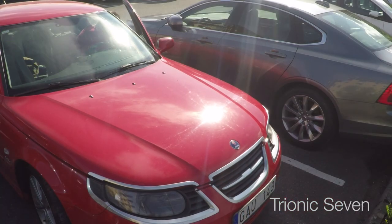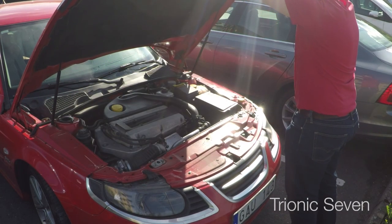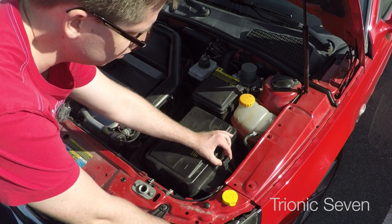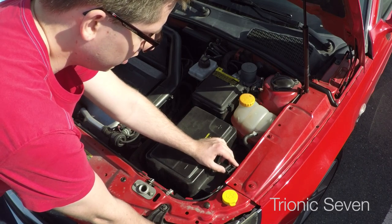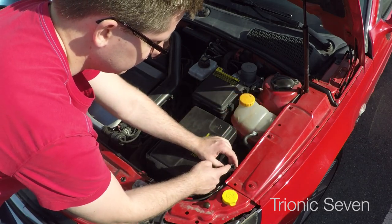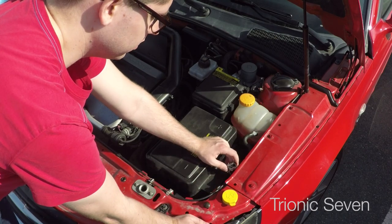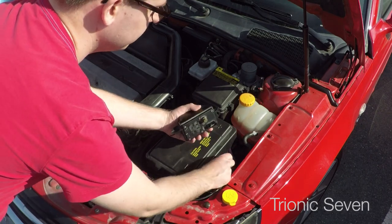I'll begin by installing the siren. The siren is in the front left wheel well, but I highly recommend when you do the retrofit or reinstall or rebuild that you pull the cable out to the engine bay. If you are retrofitting you will still need to lift the car up and open up the fender liner because this cable is fastened inside the wheel well. The reason I recommend this is that if something needs to be changed you'll need to lift the car up and remove the wheel just to check it out. When everything's done and tested I will put the siren back in its original location.